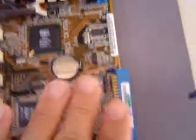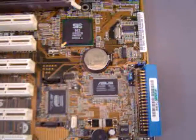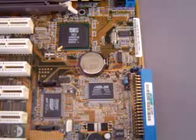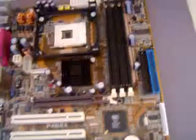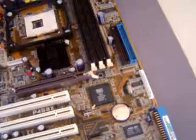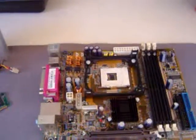Now what you want to do is go into the BIOS. When you start it up, it's going to take you right into it, and you have to configure it to the settings that you want. Mostly your drive, your boot schematic, basically which one you want to boot first, and graphics and all that stuff, goodies, and just go through there. If you overclock, then you're going to set your voltage on your CPU. Also the RAM, and also you want to boot it. And if you can't boot it, then your first bet is going to be in your CMOS and your BIOS.